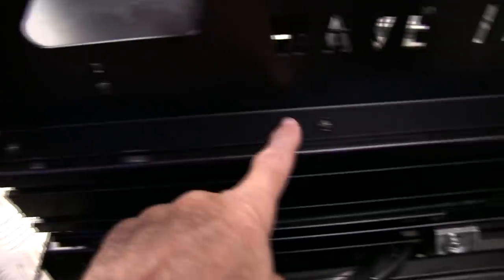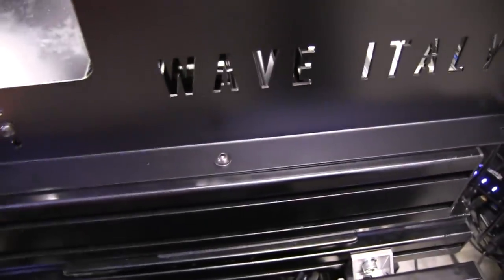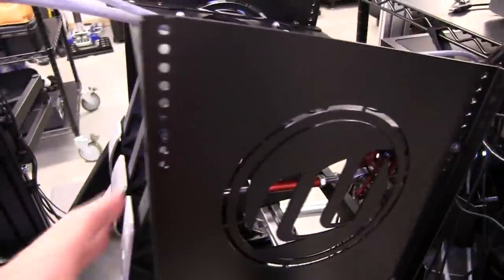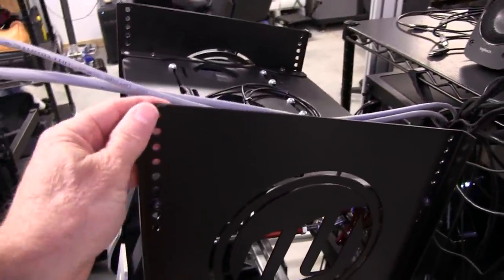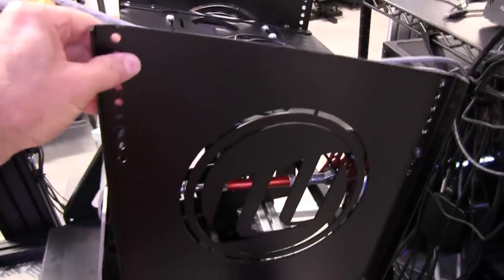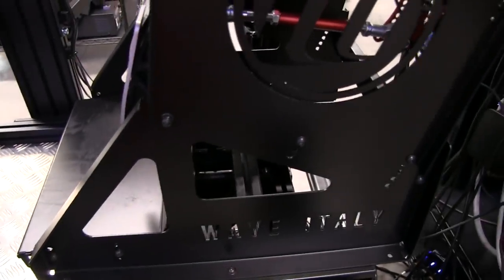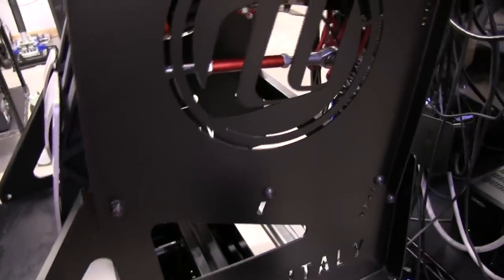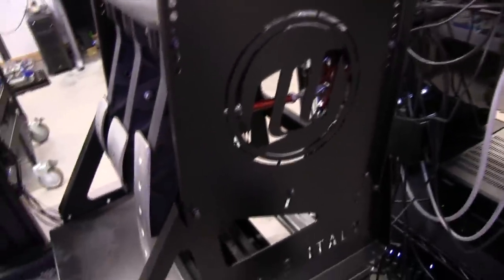And we'll go around the side here. Same thing here. We have the front M6 and the middle M6, and the other one's kind of hanging off the back. But again, I don't notice anything detrimental so far in what I've been doing with it. Now, there is some flex on the lateral plane here, because obviously this system was not built to be pushed laterally. So I can actually pull on it, and of course, I'm pulling at the top here. It's a pretty long lever down to the bolt at the bottom, but you can see it moves a little bit. But when I push it this way, it's not moving. I'm pushing it along the longitudinal axis, which is how this bracket system was designed.